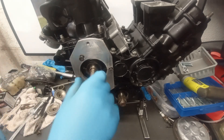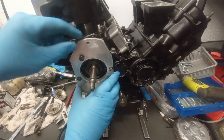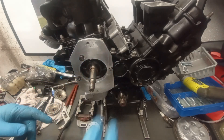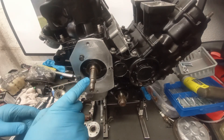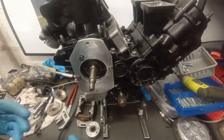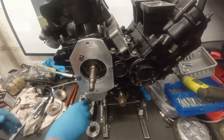A self-generating one's a better option. What Dave Johnson did was he made this aluminium plate, which I've just loosely put into place. The crankshaft here on the RD500 would have had a taper for the flywheel to push onto. Dave Johnson machined this down and machined a cutout for the Woodruff key, so it can accept the ignition system of a TZ500J — of the four-cylinder GP bike.